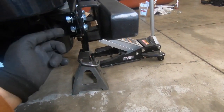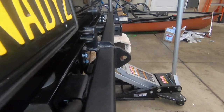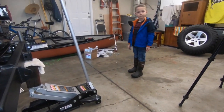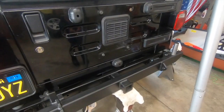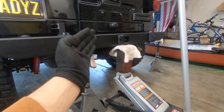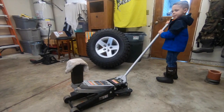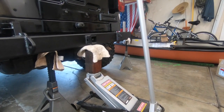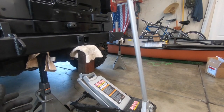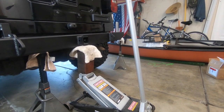We've gotten all the bolts in — two right here, and as you work down the line there are two more, then six and eight total. My helper showed up to say hi. What we had to do was use jack stands, and because the bumper wanted to pitch top-side-heavy forward, we also used a jack with a block and a rag for padding to lay the bumper up flat against the frame rails. That made it easier to get the bolts in. This could be avoided with a friend helping, but honestly it wasn't that hard — a jack stand won't complain it's tired or want a beer or go watch TV.